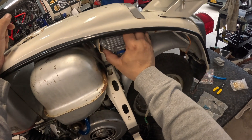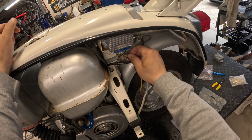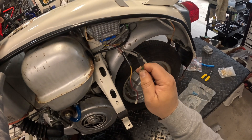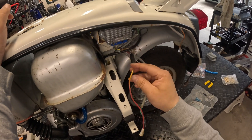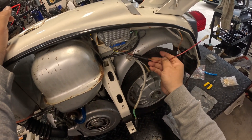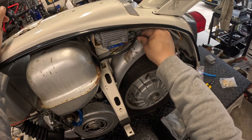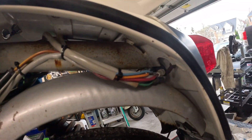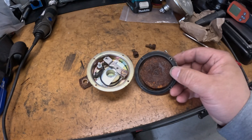It's not much to the wiring — as long as your parts are good it should work. I replaced the regulator with the new one, and I have the wires all plugged up again. I actually cut off that mess and just terminated this one brown wire. The kill switch wire — if this grounds out while you're riding it'll shut the bike off. The red wire going to the battery and the turn signal flasher wire aren't doing anything anymore, so I'm just going to zip tie these up nice and neat. Wiring is all cleaned up, zip tied, everything terminated — this section is done.